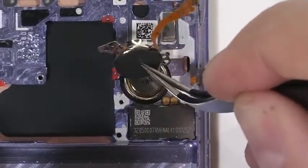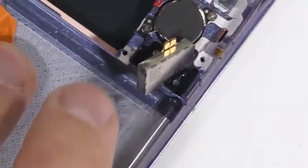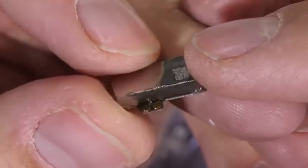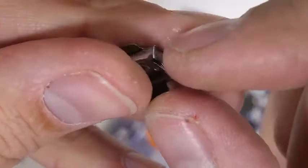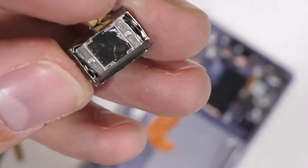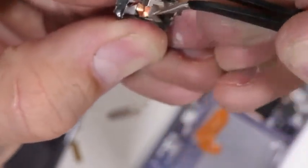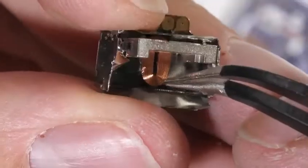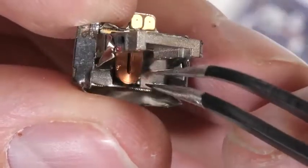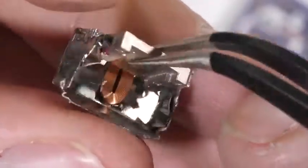The magnet inside the speaker is super strong. The vibrator motor is also over here — it's rectangular and super small. Breaking it open reveals an outer casing with another smaller box inside, and inside that is a copper coil with two magnets inside the metal frame that acts as the hammer of sorts. The energy coming through the copper coil can move these magnets, just like in a speaker or a motor, which makes the inner metal vibrate against the outer metal shell. They call this an X-axis linear actuator.